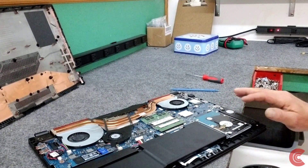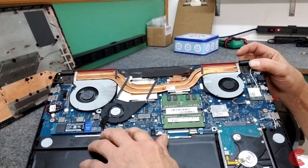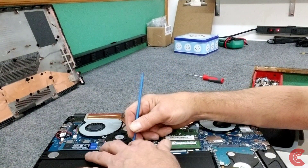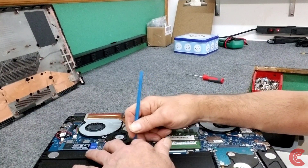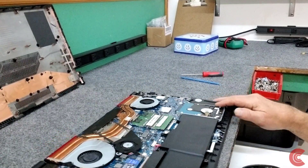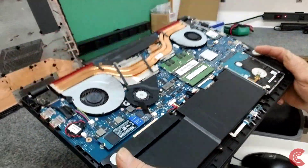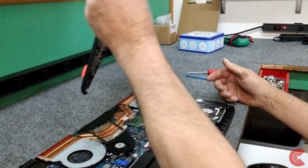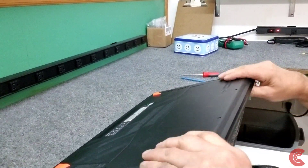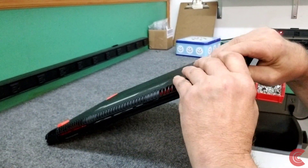Watch your speakers of course — you don't want to let those get out of place. Now I'm going to reconnect my battery here. You see it just pushes back down, but you've got to remember to push this little metal clip back in place to hold that connector on the motherboard. Got the new NVMe drive in right there, put the screw back in — it's pretty much that simple. This model has the Intel Skylake i7-7700HQ processor in it, it's pretty fast. Snap the bottom pan back on, take your time with it.